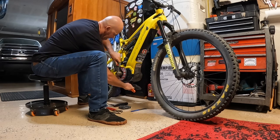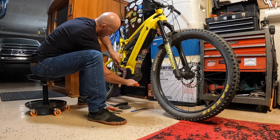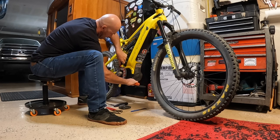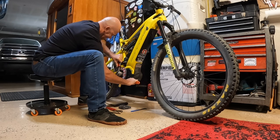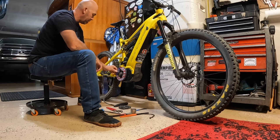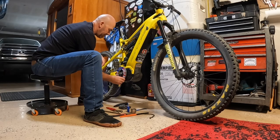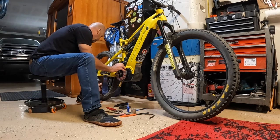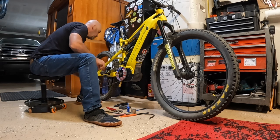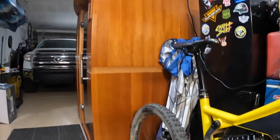I don't know where everyone lives, but I'm in Southern California and today and yesterday we had a little bit of rain, quite a storm actually. When it rains here we get it all at once, but it's nice to get some moisture — it's going to make the trails a lot better quality. Let me throw this chain on here. I want to check the chain alignment — they said positioning the chain ring toward the middle improves alignment, so let's check that out.